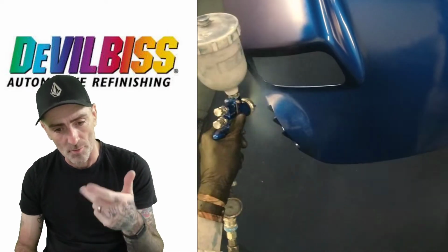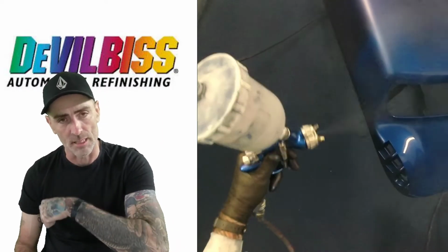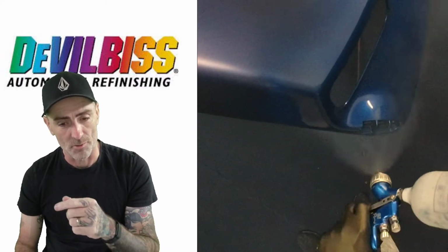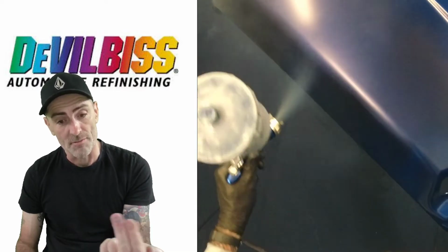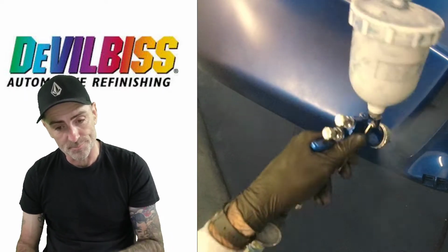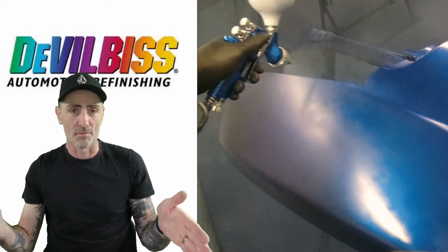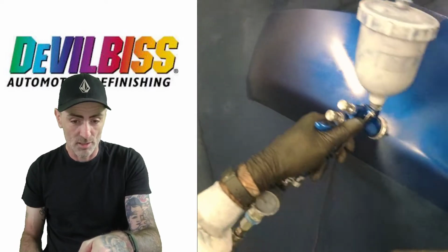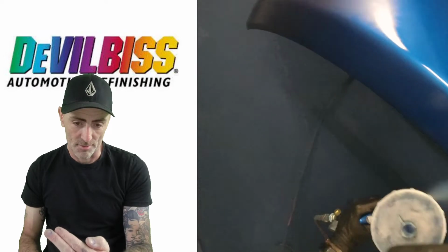So you're always on and off the trigger doing these. Very rarely are you full on the trigger. You're basically feathering the trigger as you're working around these panels. A little bit round where them switches are, and then going on the underneath side, working around the top. And I do it in passes, like I said before. I'll go sort of a pass of 2 feet and then work my way along, as you see there, down on that side, catching that underneath, and then working back up.